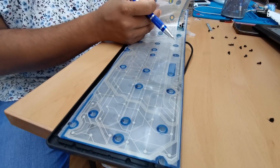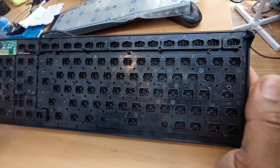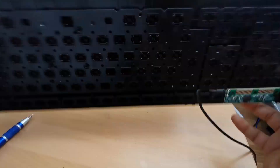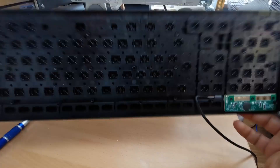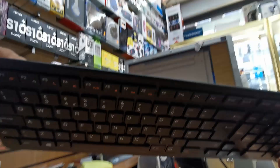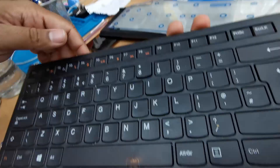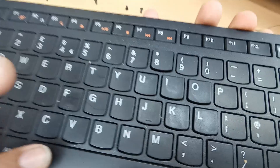Now, how do you find out how many buttons are not working properly? You can listen to the sound. As you can see, buttons one, two, three, four — the sound seems like those buttons are free. But looking from the top, you can see that five buttons are still upright — the reason is they are stuck with a kind of sugary glue.